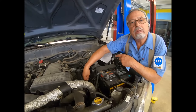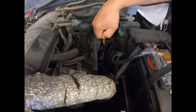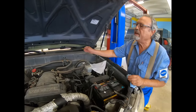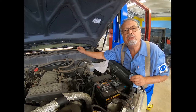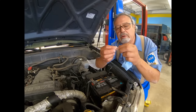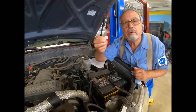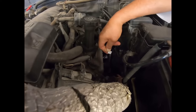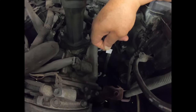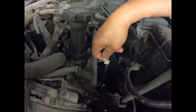We're going to find the dipstick — as in the engine oil dipstick. On this particular vehicle, it's here. I'm going to take the dipstick out, wipe it off a little bit, and put it in a safe place. Then I'm going to take this analyzer paper and test it to see if it fits over the dipstick tube. This looks like a good fit — you want one that's pretty close to the right size.